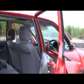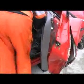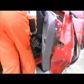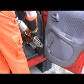If you have a look at the top, you can see at this particular time we're not cutting the top of the B-post first — we're going to do that after the rip. The reason for that is that if we get any problems doing the rip, hopefully that'll stop the top of the B-post from encroaching in on the casualty.